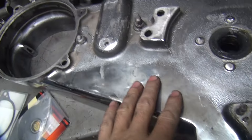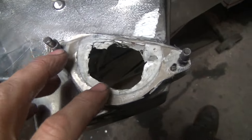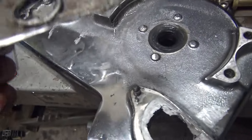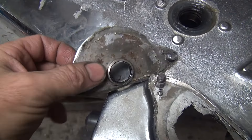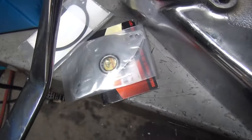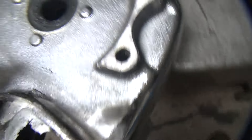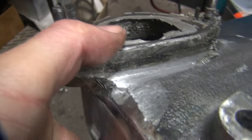When I get back on this bike, we'll get this primary cover put on here. I took off the starter plate, which is all chewed up. You can see it's all eaten away and ovalled out — not round anymore where it goes around the starter. We're going to replace that with a new one. We'll have to glue this all in here because it's so eaten out underneath. It's all worn real heavily. The chain too.